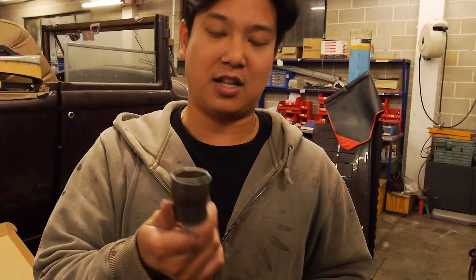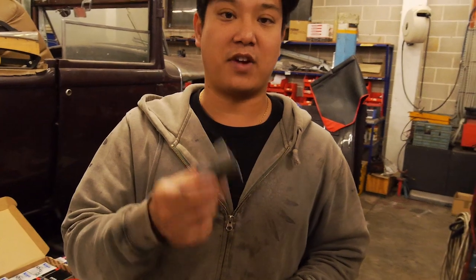When you're using a collapsible spacer, you only wind it on just fractionally, just enough till you get the right torque when it's assembled on the bench. And then in service, things are gonna move, heat, cool, and those bearings are gonna move up against the abutment if they weren't already up there. So, that'll make more sense a bit later on when we have a look at it.